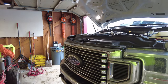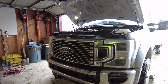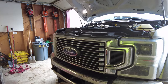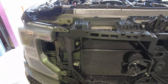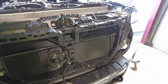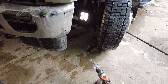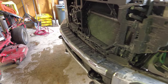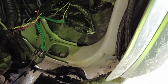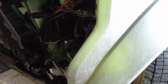I've got to take off the grill, take out the headlights, take off the top cover — a lot of stuff to get this old kit removed. I want to put the two kits side by side and see how different they are. So I was able to get the headlights out and the top cover off. For the headlights there is a side bolt on the actual fender flare that I had to take off to get a 13mm in there.